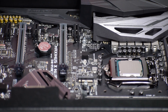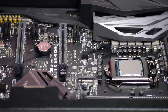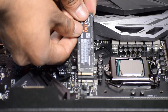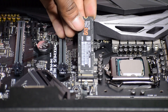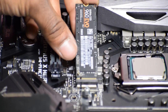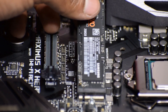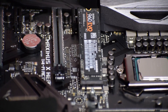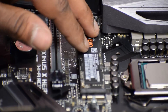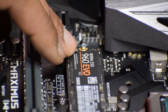I'm gonna put the NVMe in there and the heat sink is gonna press down on top. To install the NVMe SSD, you pretty much just line it up in here on a 45-degree angle, try to get the right angle, and push it in a little bit. There you go — it pushes in all the way, nice and snug. You would then press it down and screw it in. You can see right there — that's the screw that lines up with the screw hole.